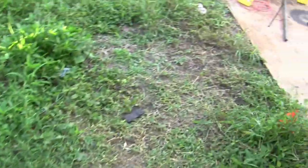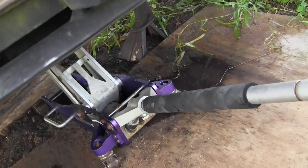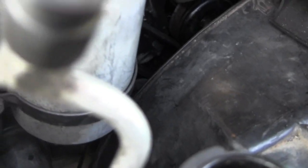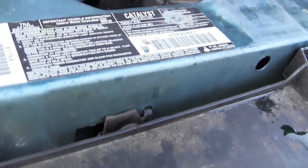Well, at least it's cranking, and it sounds like a normal crank. I don't hear any backfire or pushback. Or okay, it's holding coolant pretty well. Let's see what we're leaking under here. Alright, well, I'm leaking something, and it seems to be in this area here somehow. So maybe I got a line that's not tight enough on the transmission cooler, I would guess.